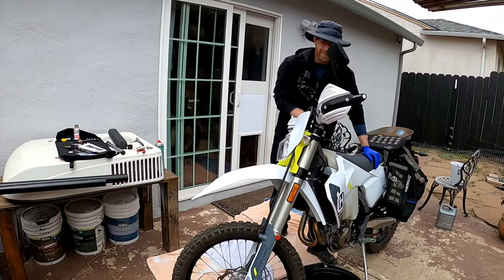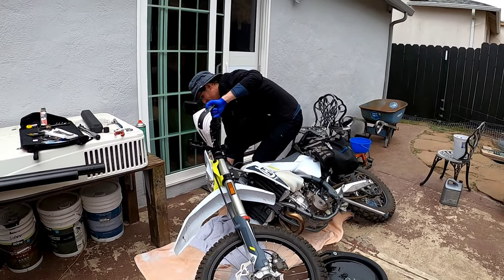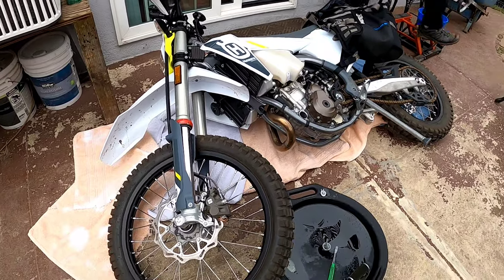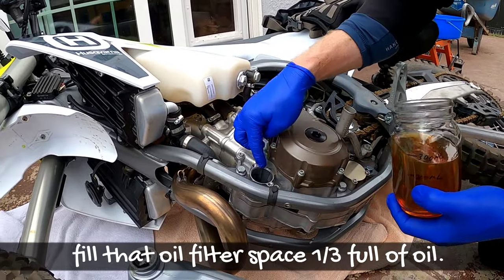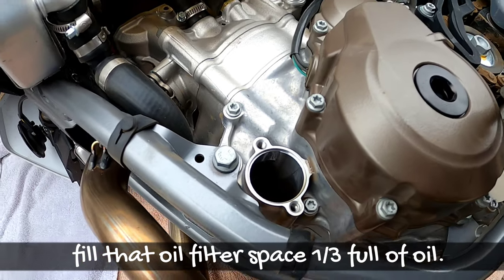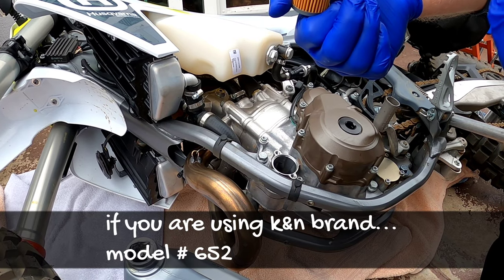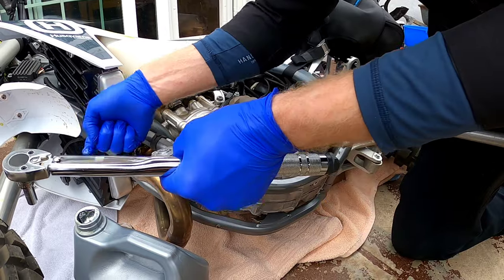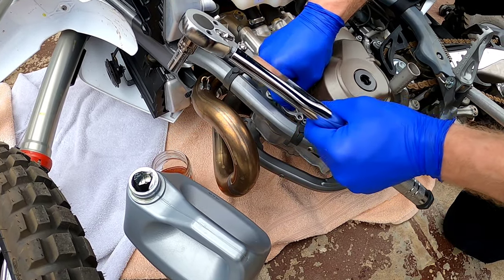So this is actually the first time this bike's been dropped. You have to lay the bike down for this part. We put some towels down on the ground just to keep it nice because it has never been dropped before. We're going to fill this one third full — fill this little cylinder here. Drop the filter in there. So the rubber gasket goes on the bottom. We got a K&N 652. Just get it to pop down in there. After cleaning the cover, time to put a little bit of clean oil on it. Snaps into place.